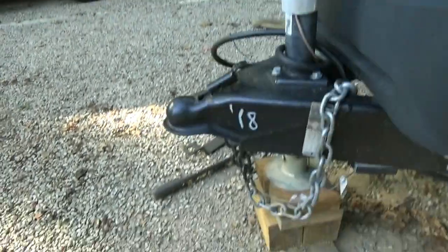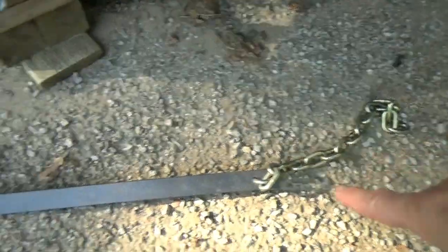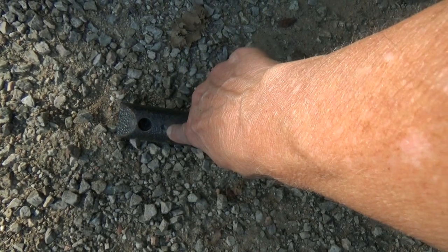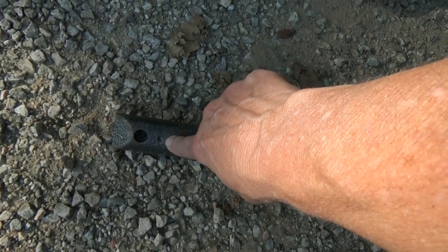One of the things I really liked — one of the selling points — is that if I ever trade trailers and get something larger and heavier, I don't have to buy a completely new hitch. The part that connects to the truck stays the same, and the part that mounts on the trailer is the same. What changes are the bars. The bars have a chain on one end and snap in on the other. You can see there's one little divot right there. They make one with no divots that's lighter, but this is a light trailer so we have one divot, and I think they go up to three or four. So if you trade trailers, you're not buying a new system because the one you bought is too light or too heavy.